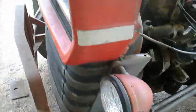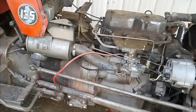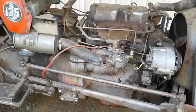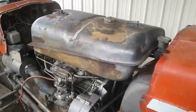I'm going to blast the tank out with a pressure washer too, inside the tank. I already — on somebody's recommendation — put a big handful of BBs in there along with a little bit of kerosene and shook it around to kind of scrape it clean from the inside a little. But I think most of it is going to be done by the pressure washer. It's a little breezy so I apologize if there's any noise.